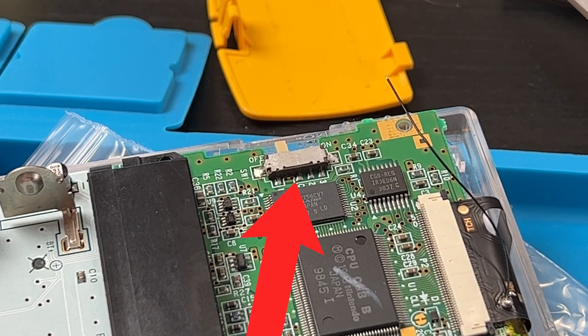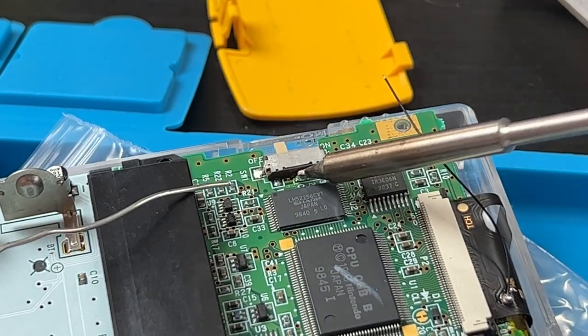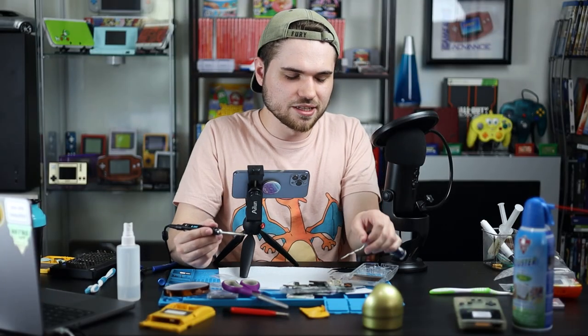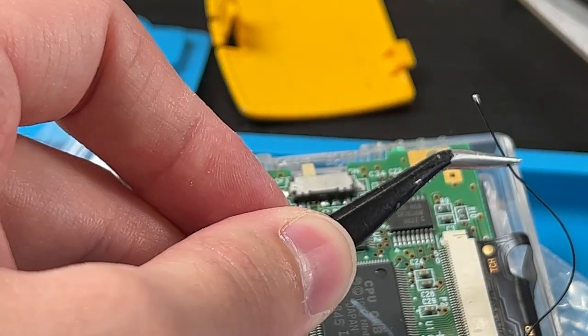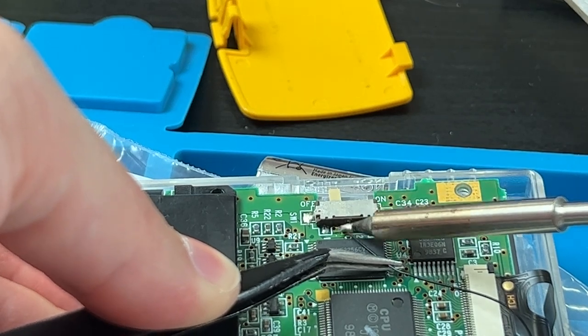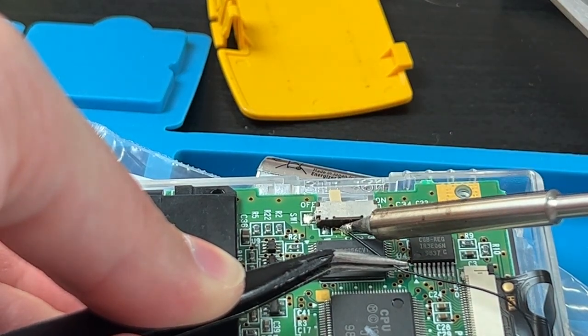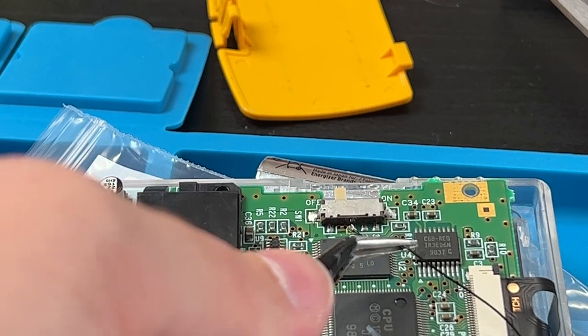Take the screws — they're all the same color. Grab your three Phillips heads and screw the center one down to lock everything into place. Stick the motherboard out and push it into place — just the reverse of pulling it out. Push the ribbon cable tabs down very gently but with some force. It might push up the other side, so just keep pushing them down side to side until both are in. From here, we have to solder the power wire to C on the power switch — this one's a little trickier. Use some flux, heat it up, press some solder in, and you can pre-tin the wire and then just put it right on top. We are done soldering.